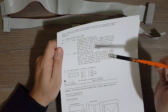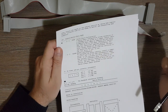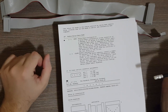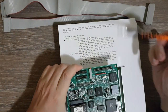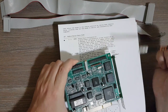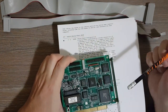In radial configuration, each connected drive has its own control and data cable, and drives always remain selected. I suppose this needs to be supported by the controller. This controller only has one connector for the control cable and two connectors for data, so with this particular controller I don't think radial configuration is possible — only daisy chain.